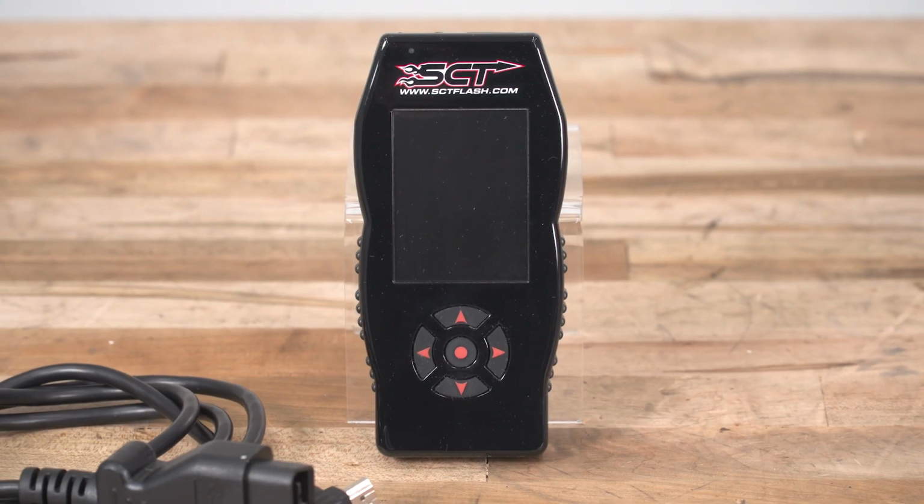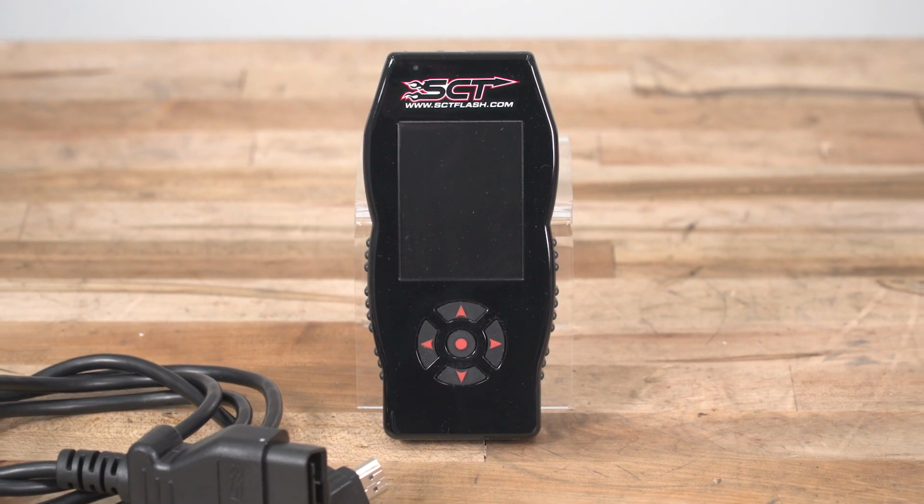They're also going to take into consideration the drive-by-wire delay, which is essentially the delay in time between hitting the gas and your throttle body opening up and your truck getting going off the line. Now from the factory, there is a pretty moderate delay there, which means it can make that truck, again, feel a little bit more sluggish. Altering that is going to make it feel like there's a lot more throttle response and acceleration, which will definitely make for a more enjoyable ride.